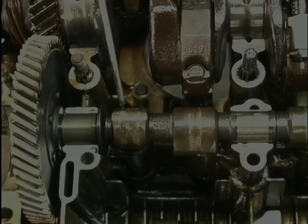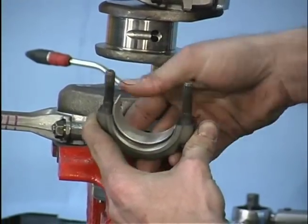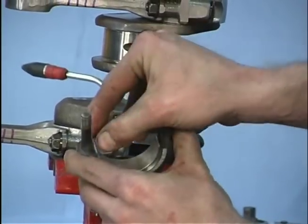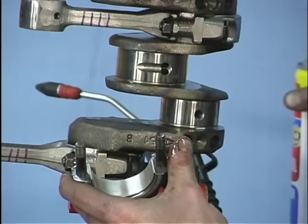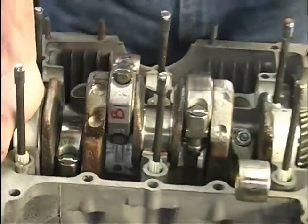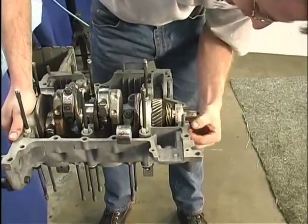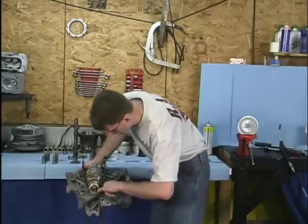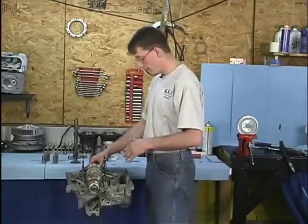I'd never reuse cams in Type 4s. Line up your little alignment tang and snap the bearing into place. I always like to take a little bit of carburetor cleaner — or even starting fluid works pretty good — spray some on here and get off all the residue from the machine work. You can always tell if it's in completely by looking underneath: there should be no air gap between the bearing and the engine case. If there's any gap at all, you need to start over. This is very important because if these dowels are out of alignment, it's going to end up ruining the bearings.